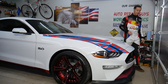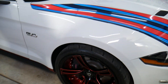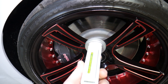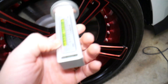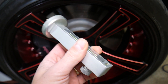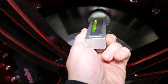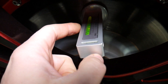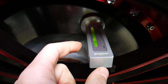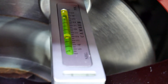With that said, let me show you our current camber readings before we share the stock specs. It just went to an alignment job and they were supposed to set everything correctly. This is the gauge I'm using — it's very inexpensive and I'll put the link in the description. You attach it to the rotor, make sure it's on a level surface. Right now we're reading negative one and a half degrees of camber on the front — right between one and two degrees.